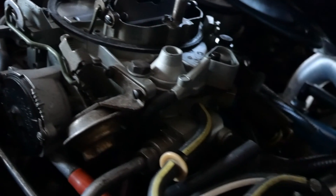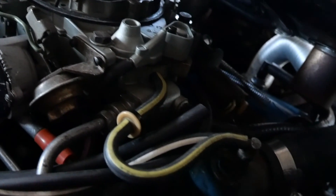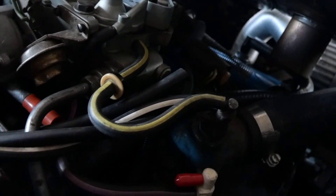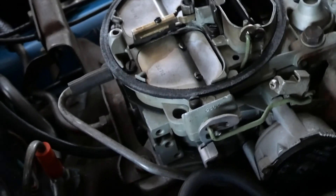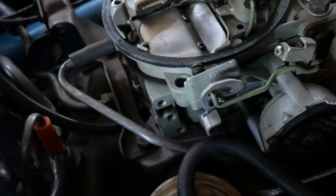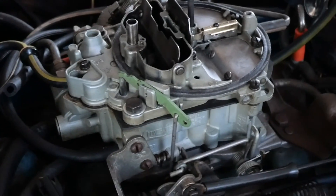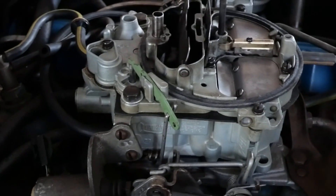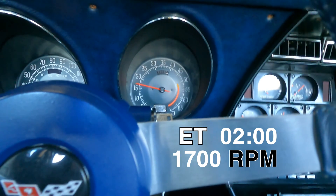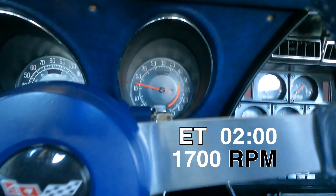Vacuum leaks. I found vacuum leaks on the hose ends, manifold fittings, vacuum leaks on the carburetor base and carburetor top plate. I still have one leak now on the EGR valve gasket, so that's why it's disconnected.